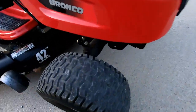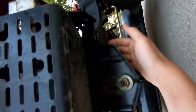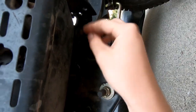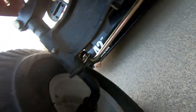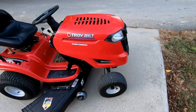The way that the front end's designed, there's literally one bolt right here holding the lower spindle-type ordeal on here. I think what I can do is take that bolt loose, take it out, and weld on some plate steel — whatever size lift I want — all the way down through here, drill new holes, and bolt this crossmember back up, therefore giving me more lift in the front.